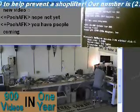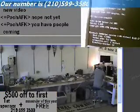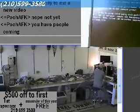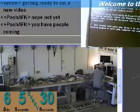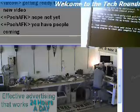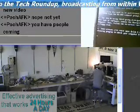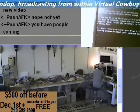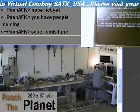Now to jump this board, we cross the pins like we do on our videos when we use the bench tester — we cross the power switch pins, and that allows the board to fire up. This test should not take more than 15 minutes. We are going to edit the middle of the test out while we're waiting for the results.